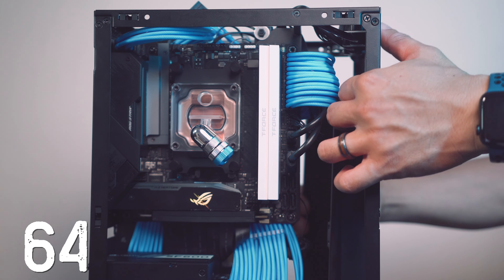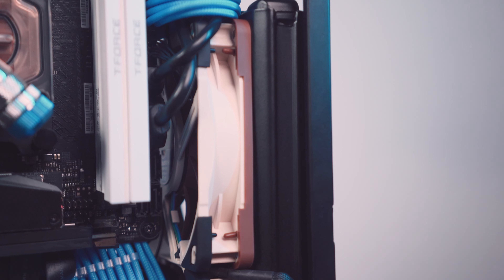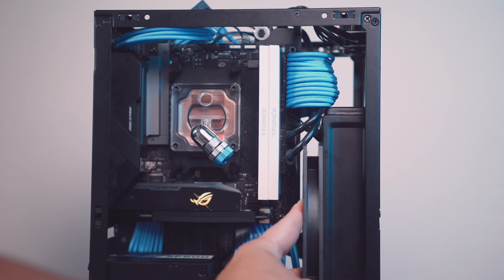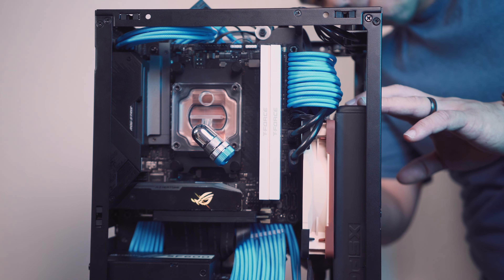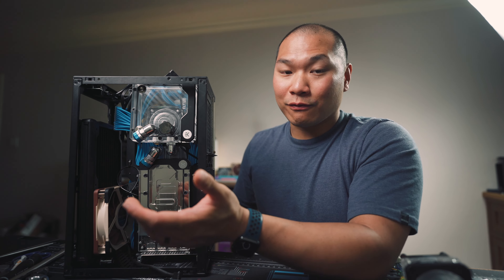Getting into rad selection, the magic number is 64 millimeters of max thickness for your rad plus fans for a 280, since you mount that directly to the case panel. With a 240, you lose about a millimeter because of the adapter plate required. If you really want the thickest possible rad, you could do something like a 45mm thick PE240 rad plus slim fans. That said, I wouldn't recommend that — something like XSPC's EX240 at 36 millimeters coupled with 25mm thick fans would give you a little breathing room, which is critical. Thick rad with slim fans versus thinner rad with regular fans — I'd always go for the latter, as the best quality fans will yield more performance.